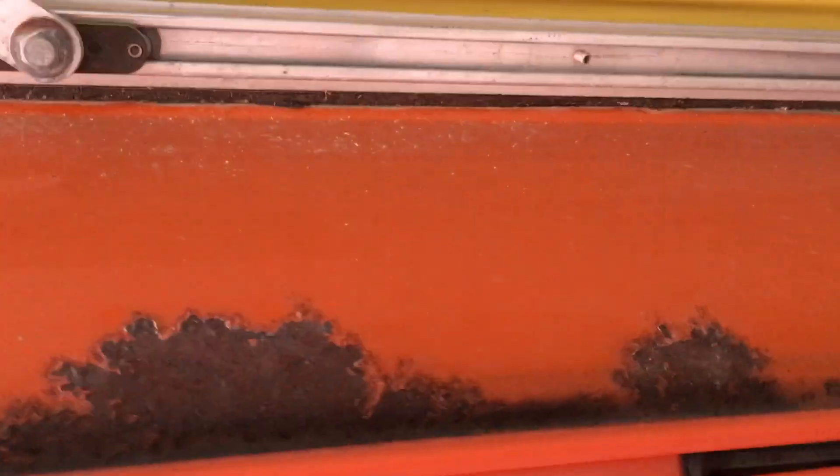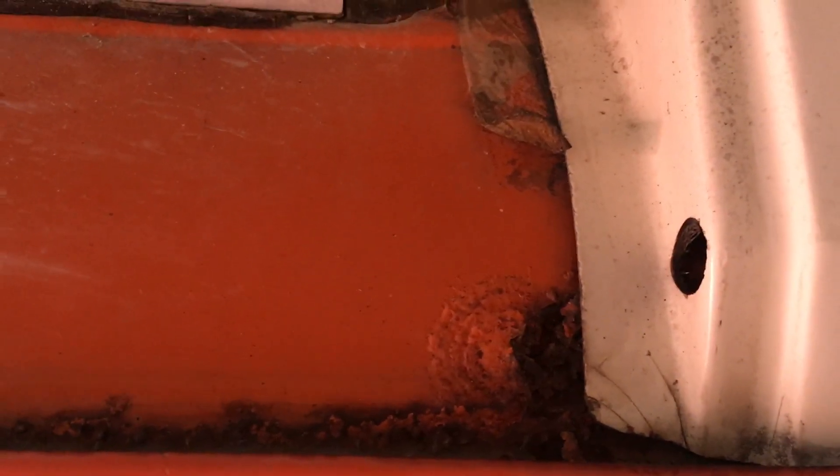Here at the rain gutter there are a whole lot of rust spots along the rain gutter, so those have got to get dealt with. I think those are bad in part because it was a Washington bus, and in part because the seal on the pop top is missing — so it wasn't sealing properly to the body. There's a whole lot of rust at this drainage hole, essentially because this is where all the water from the top comes in, so we're gonna have to think about how to improve drainage here.